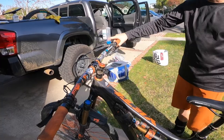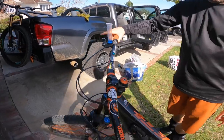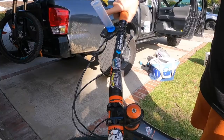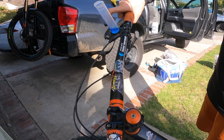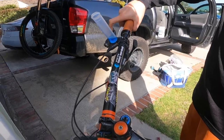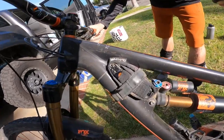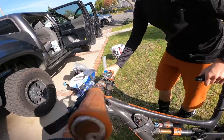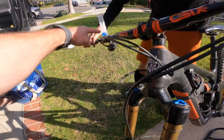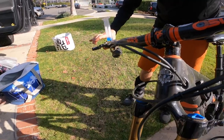There's already bubbles coming out — a little bit. So I'm going to tilt it so that the cable is below the bleed port. Really what I need to do is tilt it the other way so the bladder is on the other side. Now I'm going to tilt it this way — yep, bubble, bubble, bubble! We just saw it. Ton of bubbles, ton of bubbles — those are all coming out of the bladder where the extra oil sits. You can see them popping out right there.